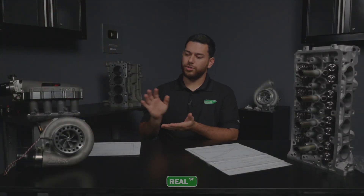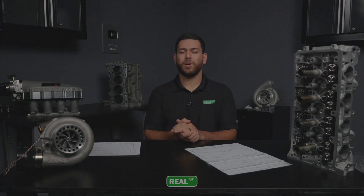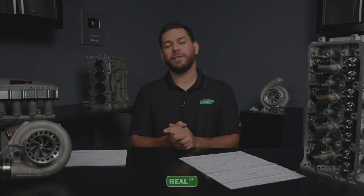While this is a stock K24 engine, we decided to still go with a larger turbo — in this case the 6466 — for a couple of reasons. This is an extremely popular option for Honda K-Series guys as the engine is very efficient and able to flow a lot of air. It also leaves some headroom if the person at home wants to run this type of turbocharger at a lower boost target like we did today, and still wants to make more power in the future by increasing that boost down the line.